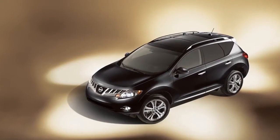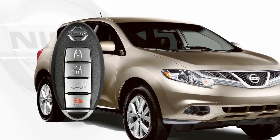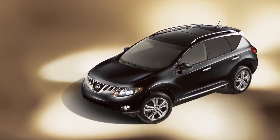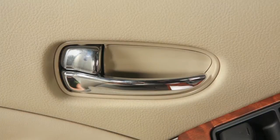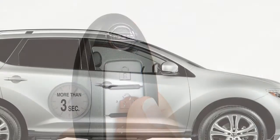The Intelligent Key is also equipped with a remote system for opening door locks and windows. It is possible to lock and unlock all doors and open windows using your Intelligent Key from outside the vehicle at a distance of up to 33 feet. To lock the vehicle, press the lock button — your hazard warning lights will flash twice, your horn will beep once, and you'll know that your vehicle is locked. To unlock the doors, press the unlock button. The hazard warning lights will flash and the driver's door will unlock. Press again within one minute to unlock all doors and the lift gate. If so equipped, holding the unlock button for more than three seconds after the doors are unlocked will lower the automatic windows.